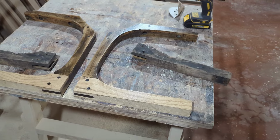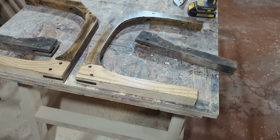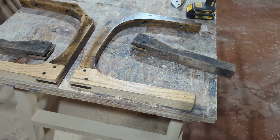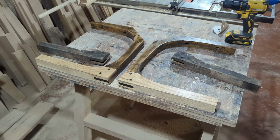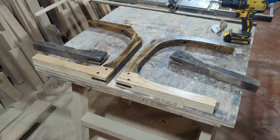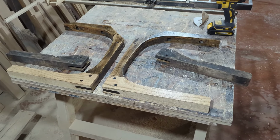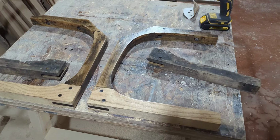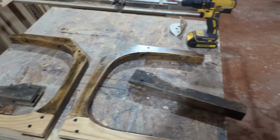These rear window woods were put together with dowels, as I mentioned before, versus when we did the Moncton Coupe, that wood was put together with screws. So obviously there was a change in 1932. Don't know which was first, but at one point they did it with dowels, and at another point they put it together with screws. Nevertheless, it has the same effect. We put these back together the way they were, with the dowels. You can see them here. Those are ready to go back into the car.